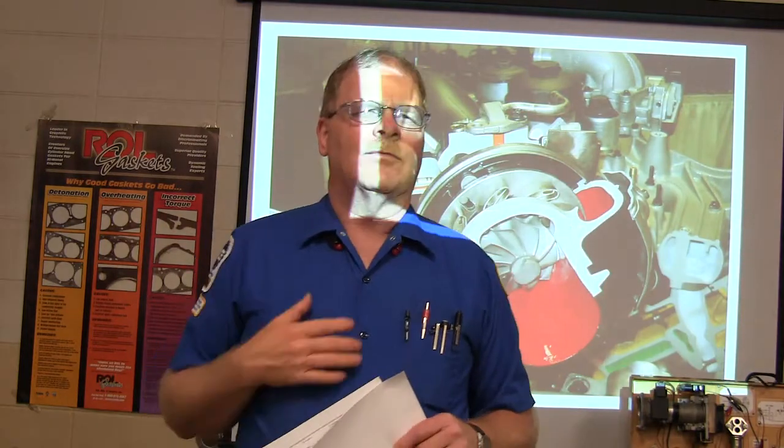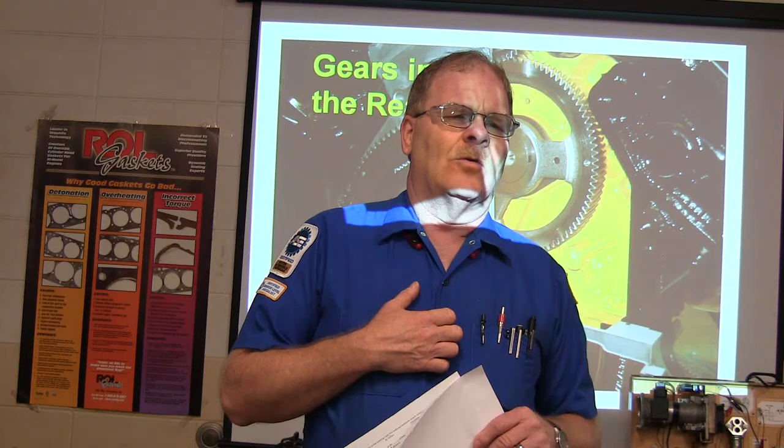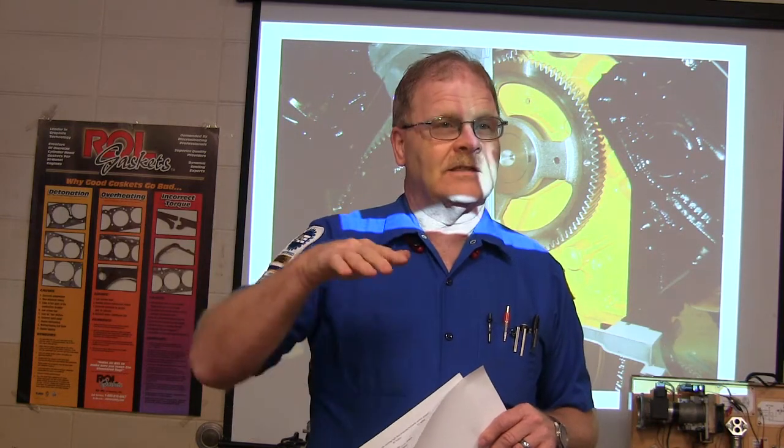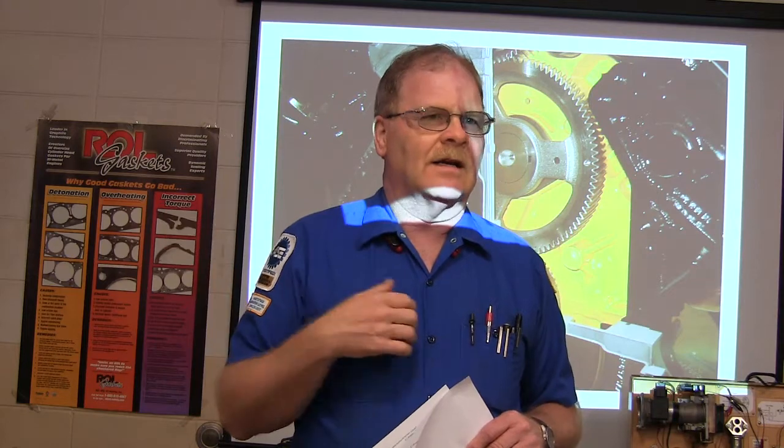It's a bad idea to do that, okay? And here's something else that I talked about a little bit the other day. For years and years, you could ask any mechanic where to put the best tires. If you're just going to put two tires on a car, where do you think you ought to put them? Put them in the rear, and it makes the car more stable. Most people like to put them in the front because they're thinking to get rid of the water, and I thought like that for years.